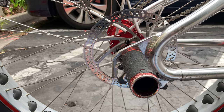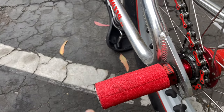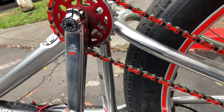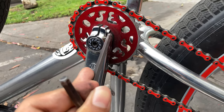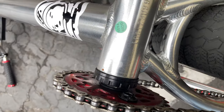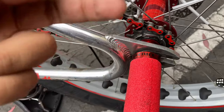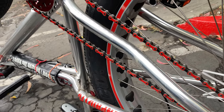I loosened both pegs — I was gonna record but ran out of storage, so I'm not gonna do it again. Since I did have to shorten my chain because it snapped, I'm gonna have to loosen this bolt, this bolt, and this bolt right here — those three — so I can take the sprocket off, pull it closer, take the chain off, take the wheel off, and do the rotor.